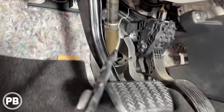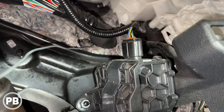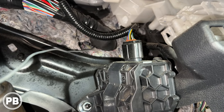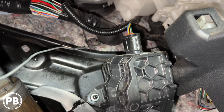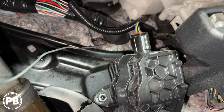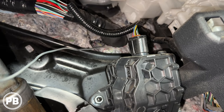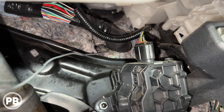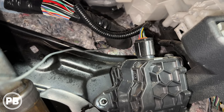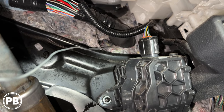Where that passes through the grommet, we go up underneath here. Right above the gas pedal is our factory wiring loom, and it goes through. We didn't go right there in the center — right up to the side of that grommet, still passing through the rubber — but we don't want to impact or damage that factory wiring in any way. Here's our wire hanger through that soft rubber, came out the other side, and we're going to use this access to pull our wire through.